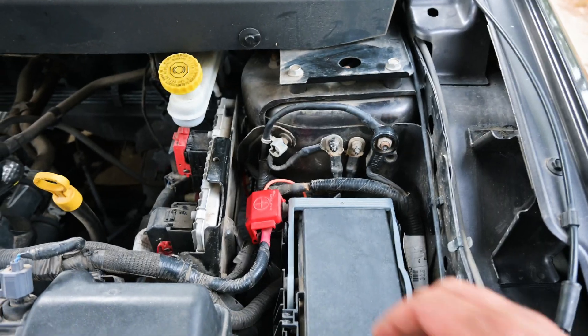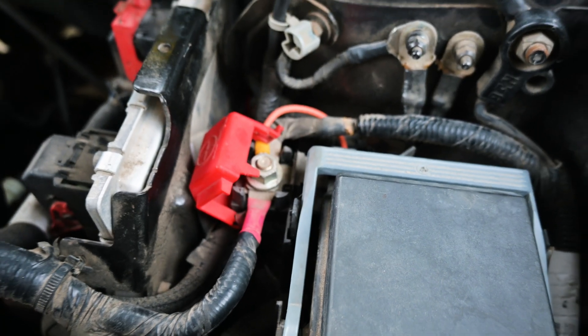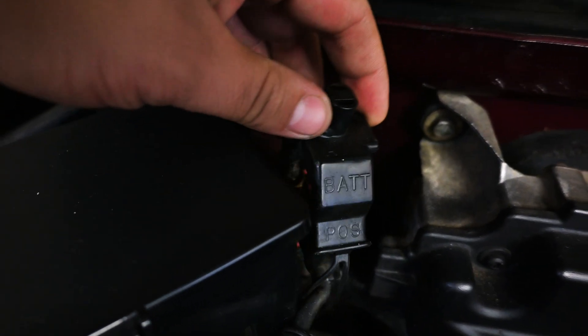If you have a side post or an auxiliary battery you can't find, always make sure you check all the connections where the auxiliary positive is going to be or where the ground is. The biggest problem I see with people charging batteries that don't have top posts is they're not getting a good ground, and that's usually because where they intend you to put the ground it's corroded. Something like a wire brush, or even a butter knife to scrape some of that off, is key to getting good connections. Like with this '94 Roadmaster I just did — there's an auxiliary positive which actually became very loose and very corroded, and when things like that happen it's very hard to jumpstart a car. Your best bet in most cases is to sit and wait at least 15 minutes once you know you've got a good charge.